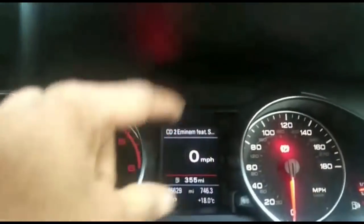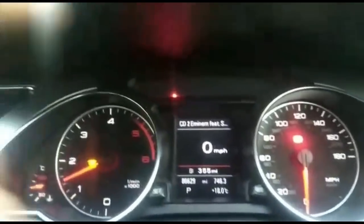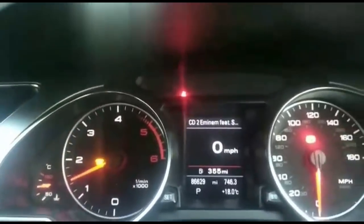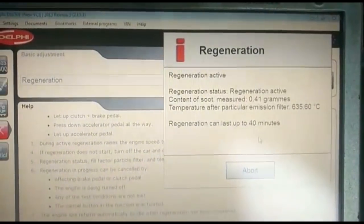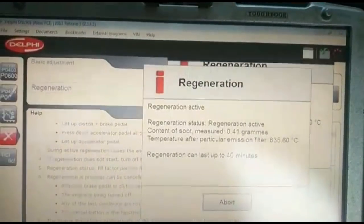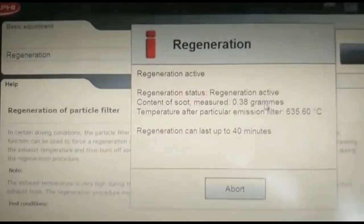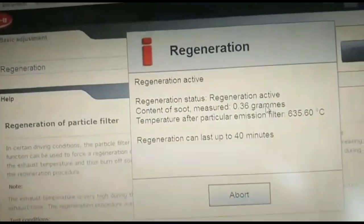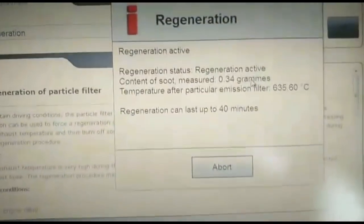In the central screen you should have a diesel particulate filter sign, and right at the top you should have the engine light — and I'm also looking at the glow plug light. The fuel, like I said, should be enough. Some regenerations can be done while driving, but this one you'll have to have it stationary. I think the stationary method is easier, to be honest — that's the way to do it.